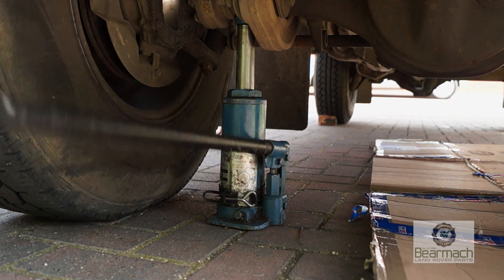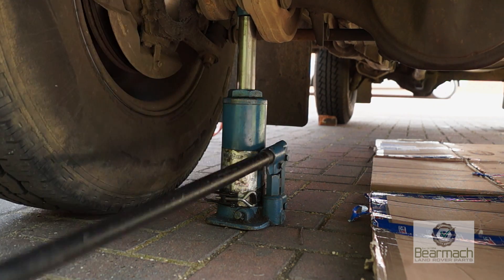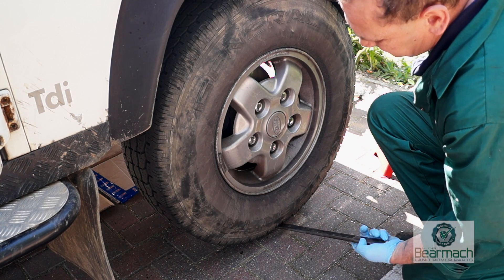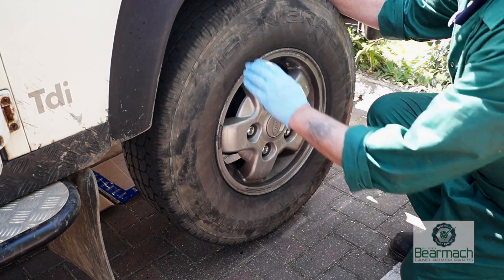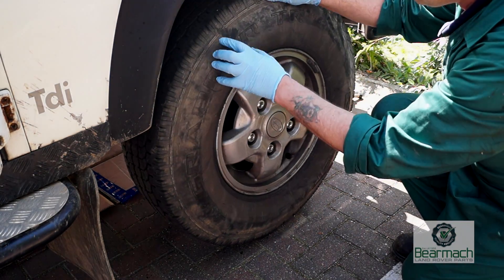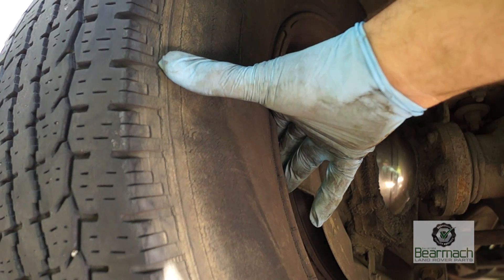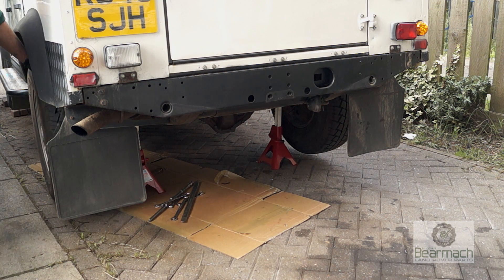Jacking the wheels up — generally the best way to do this is to go around and check all the wheel bearings before you take any wheels off. In this case we're starting at the front, checking for any lift or play in the bearings. The next thing you can do is check the condition of the tyres. You're looking for damage on the side walls, any type of cuts to cord, splitting, bulges in the tyre, or generally a misshapen tyre. This sort of checking could save your life or the life of somebody else, so take your time doing it.